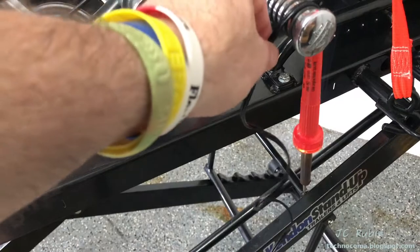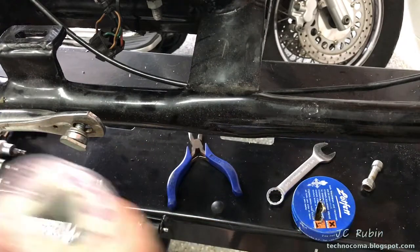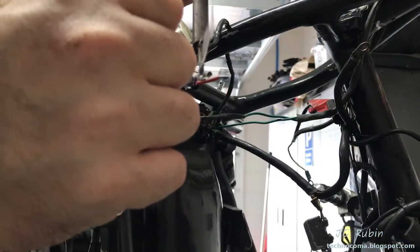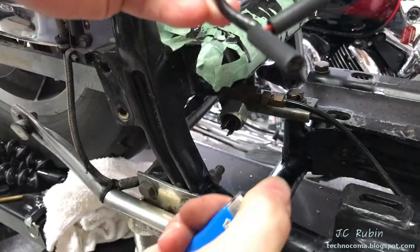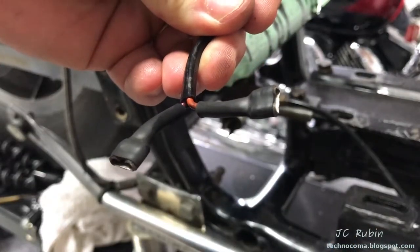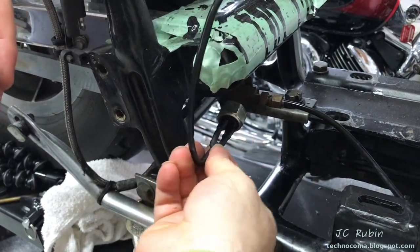The systems will be moved and agitated every so often to remove any deposits that may be stuck there. While they're soaking in kerosene I'll move on to the electrical problem and pull off the old connectors. We're going to use the same type of connectors but they're not going to be crimped - I'm going to solder them. I'll be sure to use flux generously as the wire is old. I'm also using marine-grade heat shrink; this is really good stuff with glue on the inside that melts when you heat it. The same type of heat shrink will cover the individual connections, giving us a watertight durable connector.